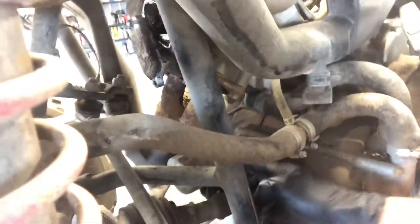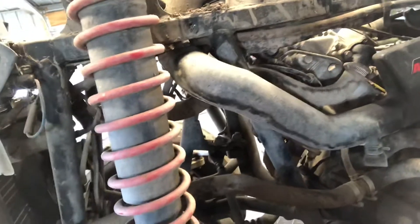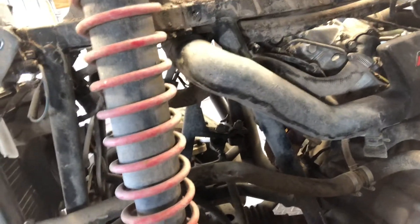The oil filter is in front of the motor, directly underneath the exhaust pipe — you can see the oil filter there. It's right above what they call the prop shaft, near those joints. Take a pair of large channel lock pliers; there are also oil filter wrenches that you can fit on there, all different kinds. A lot of times your auto parts store will carry those.